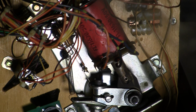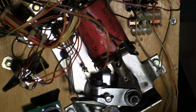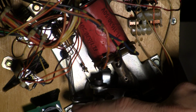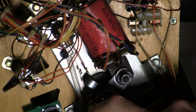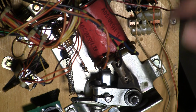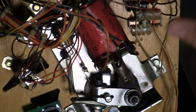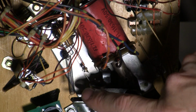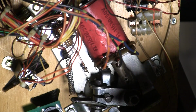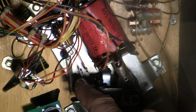What this means is that basically the low power portion of the flipper is the only thing that's mainly used until it gets to the very end, and then it switches to the high power thing. So if you held this upper flipper on for an extended period of time, it might melt the coil. It looks to me what they've done is they basically put this on backwards. This should be flipped around 180 degrees, so that instead of this breaking it, this should be slightly bent apart and it should be pushing against it.